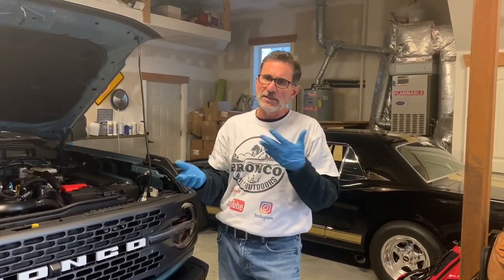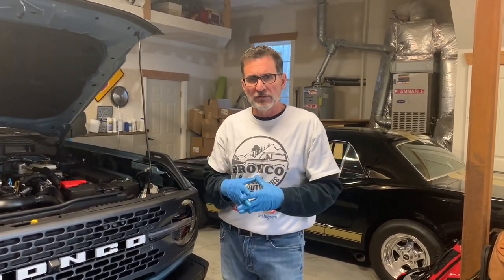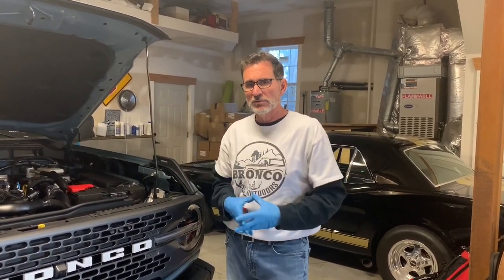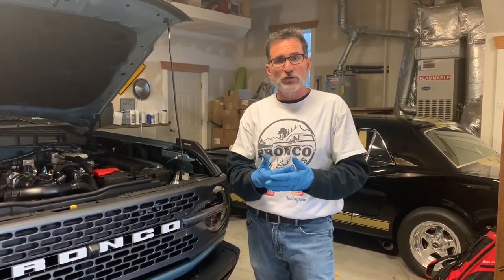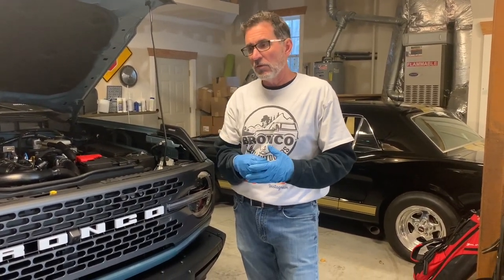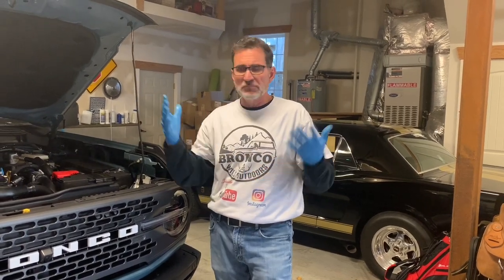For an oil change, maybe let it sit 30 minutes or maybe an hour after you've brought the engine up to operating temperature. Let it sit for maybe an hour to do that oil change. Maybe not the 15 minutes, maybe even 2 hours. The engine oil is still going to be plenty warm in 2 hours as long as it's not below 20 outside. So basically, we know that this engine has a slow drain back period, and that's good because that means there's oil in places in the engine where you need it whenever you're cranking it up. The only negative would be a little more time to drain the oil if you want to get 100% of it out. If not, changing that six and a half quarts and freshening it back up, not overfilling it, is fine, and you're doing well.